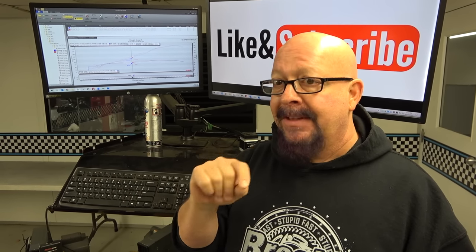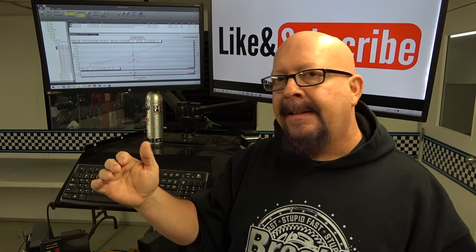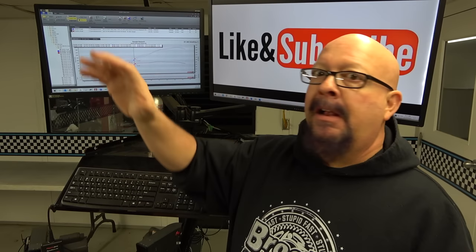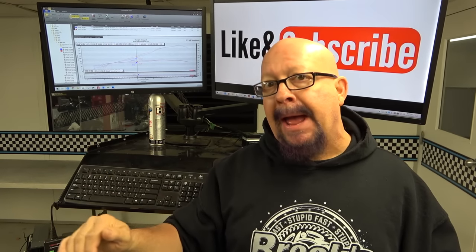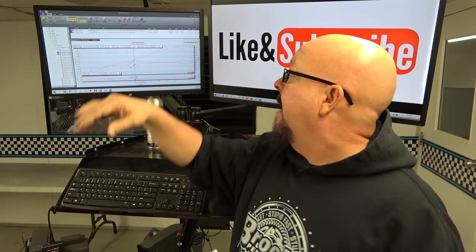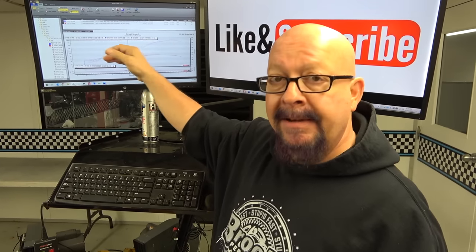And I can tell you what, this motor, I'm gonna let you in on some stuff. This thing set some records on our dyno. But one of the things that Kawasaki did, they sort of robbed Peter to pay Paul, that bike doesn't have a lot of bottom end power. It's got loads of peak. So anything we can do to pick up the bottom end power and the mid-range through here is just nothing but gravy, especially if we don't lose peak power, which we didn't, we gained it.